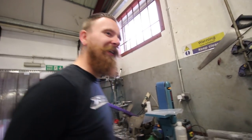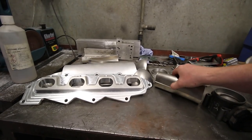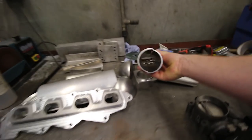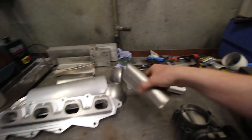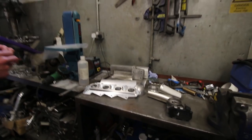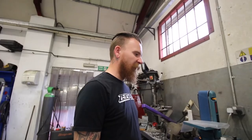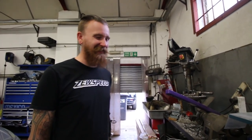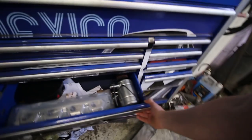These are completely unneeded because the inlet already on there is actually really good, but something to do. Hopefully this inlet with big tapered runners that are a lot longer will help with low-down torque and mid-range without really sacrificing top end. The plenum is a lot smaller — maybe two and a half to three litres — hopefully making it more responsive and drivable. If I keep saying I want a drivable street car I should put a Rover inlet on it, but who wants that?